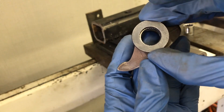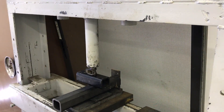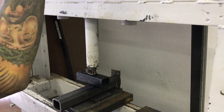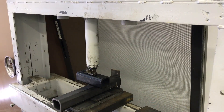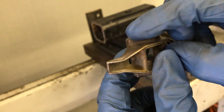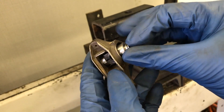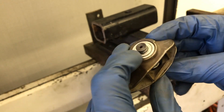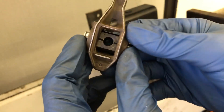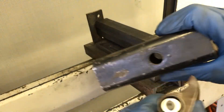You want to put one of these assembly washers over the bearing and kind of center it as much as possible so that the bearings get pressed in there evenly — you don't want them to go in there crooked. You can see it's just flush with the body of the rocker arm. Then we'll take our trunnion and slip it through the opposite side until it's flush with the bearing we just pressed in. It doesn't matter which side goes which way because this rotates. So now this piece with the hole comes in handy — that'll sit your trunnion right over that hole, just like that.